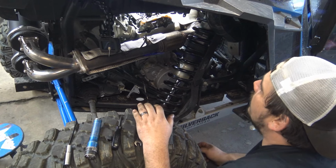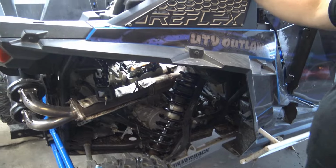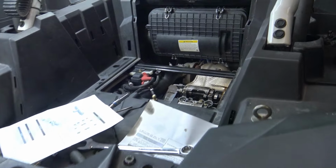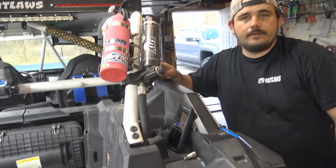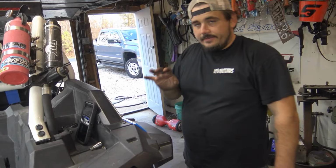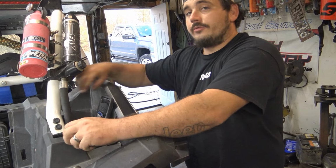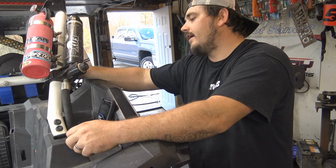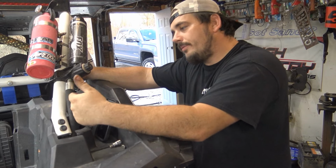So, I think we're at the point where we can pull that plate and rotate the motor. You want to Loctite those? Not yet. Bolts? Oh, okay. Not yet. As we rotate it, we're going to Loctite those. Basically, they're tight right now. There's still one out, one missing. And so as we rotate it for the first time, that'll be the first one that gets its Loctite. But it rotates counterclockwise, so you can go up there.